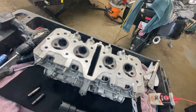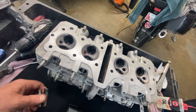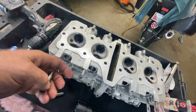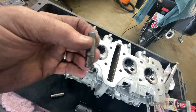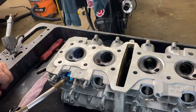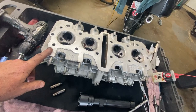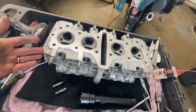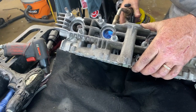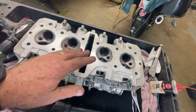So this is where we're at. I've been doing some experimenting today and what I ended up doing was driving out all of the valve guides. This is an exhaust valve guide, that is an intake valve guide. These are steel valve guides. What I'm reading online is that you're supposed to heat these up — just warm the spot around where you drive it out. Some guys say put it in an oven at 300 degrees for 45 minutes, others say just hit it with a torch and warm up those areas, then let each one cool substantially before moving on, which is what I did.